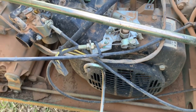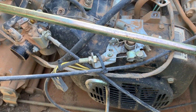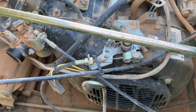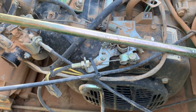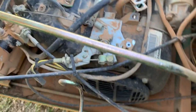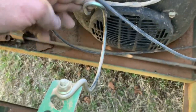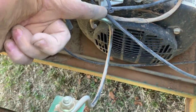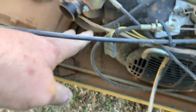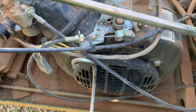We've got the ignition coil in — we actually had one at the central hub. It fits a Kawasaki FE350 as well as the FE290D; it's the same coil. I went ahead and removed the air filter, which is going to gain us clearance, and I'm going to remove the air filter bracket. Then we'll start removing the blower shroud bolts — pretty straightforward repair.